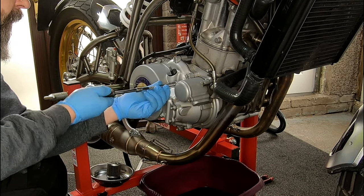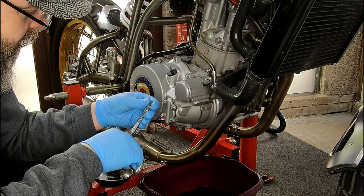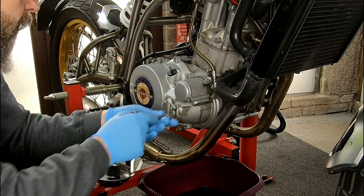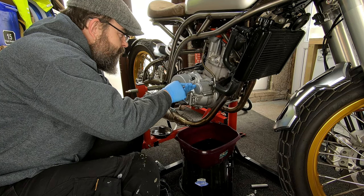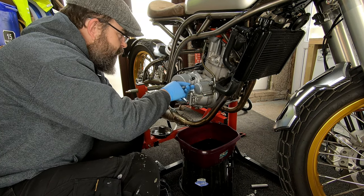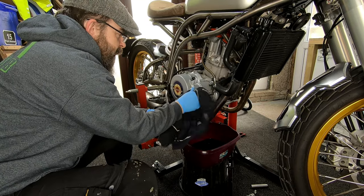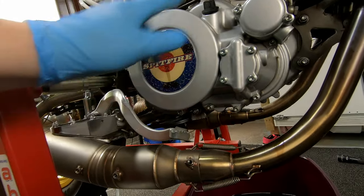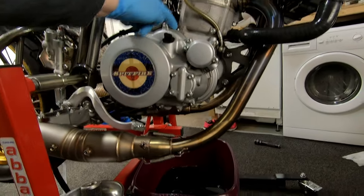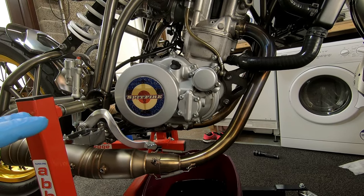It's quite delicate engineering on these engines — I'm used to doing Land Rovers and big heavy stuff. The socket size is 8 millimetre. There will be a torque setting — I'd say it's probably around 12 or 14 Newton metres, because that's all it was. It's only got an O-ring in it so there's no issue regarding that; it doesn't have to be horsed up.